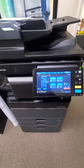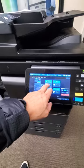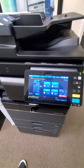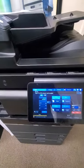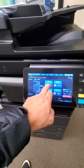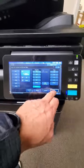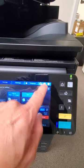For those of you who do constant Mixed Originals and want to skip the step of having to constantly hit Zoom, Mixed Sizes, and OK, you can memorize the screen or create a new icon so that you don't have to constantly be hitting that. I'm going to show you how to do that. So let's say you're at the default here — you go back in, go to Copy, Zoom, Mixed Sizes, hit OK. Now you're going to touch the plus button next to the home icon.